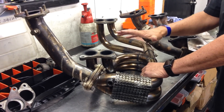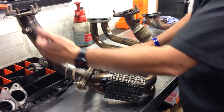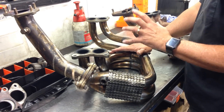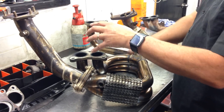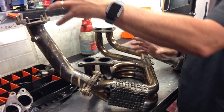You're talking a higher price than normal for something that's going to last a lot longer. The only exception is this particular one doesn't have a flexible joint in the out pipe, which we normally try to include. A lot of aftermarket Japanese extractors don't have a flexible joint, which I'm not entirely comfortable about, because there's a lot of growth and shrinkage of these components when the engine is in its operating conditions — it glows really hot and shrinks and expands.